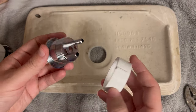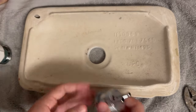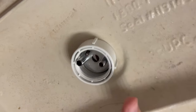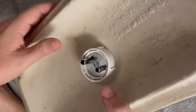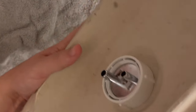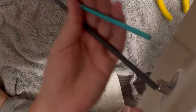Now we can go ahead and get our new push button rod installed. We're going to take the silver piece and just put it down underneath. We have the push button housing here — we're going to screw it on. You've got these two pieces sticking out and we have to make sure those are pointing down in towards the toilet tank.